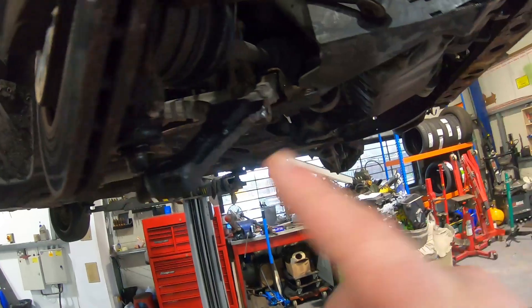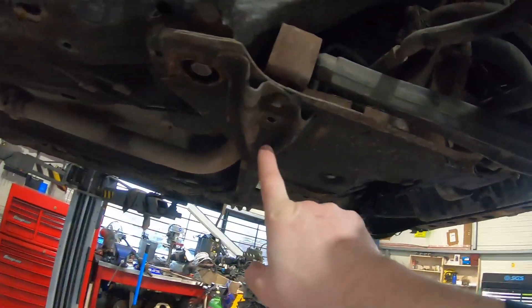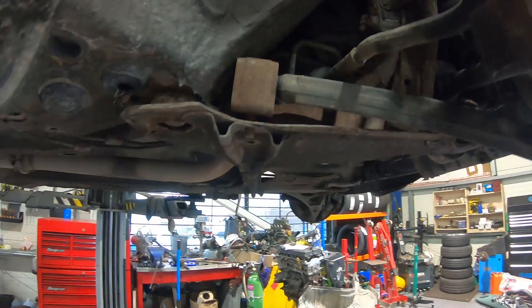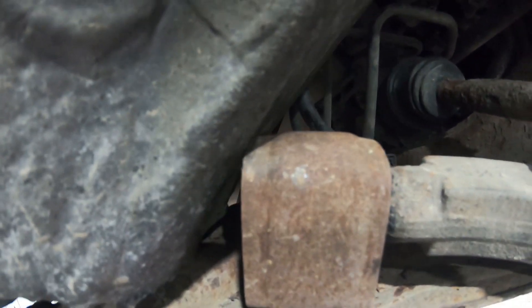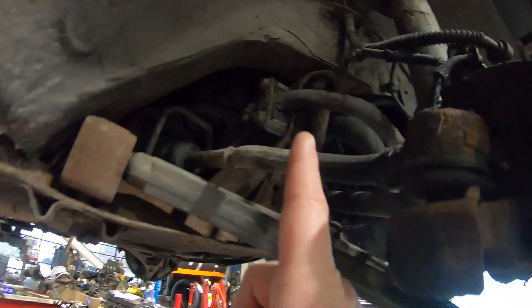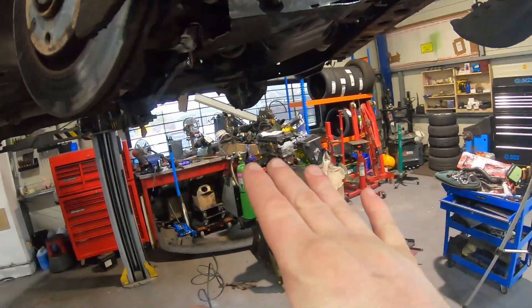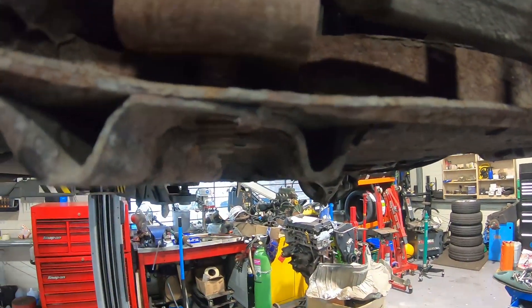Alright, arm is all undone. That is 19mm and everything else is 18mm - there's a nut and bolt, and so is the rear inner one for this rear bush. As you can see the bracket is touching the chassis and I've still got thread sticking out, so there's no way of getting that out without dropping the subframe. The subframe bolt is there and just up there - you can go up through the hole in the arm. I'll probably undo the steering rack and then loosen the other side to see if I can drop this side down enough. It's probably not even a quarter of an inch of clearance I need and the arm should come out.